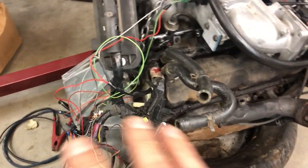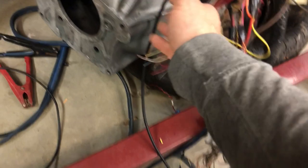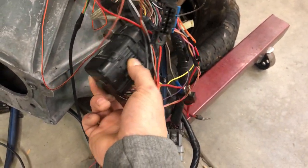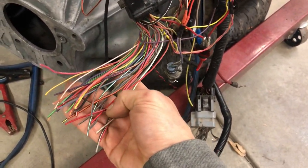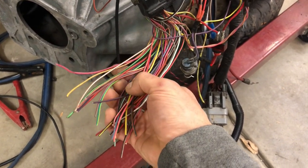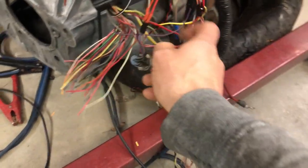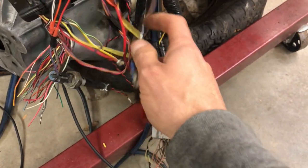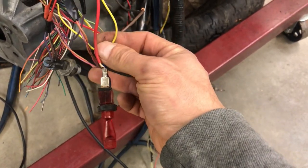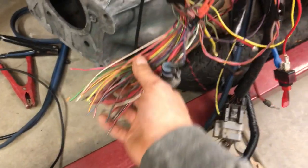As for the wiring itself, if you're looking to swap, this might look like a mess, but it all boils down to just these two plugs. There is a 42-pin plug — this is the vehicle-side plug. All these wires here go for things like speedometer control, cruise control, AC, those sorts of things, as well as switch powers and keep-alive power. You can see those here: this is the switch power, and this yellow one is the keep-alive power. So really, those two things are all you need to power up the computer itself. The rest are just auxiliary features.